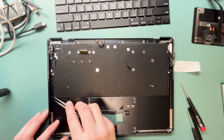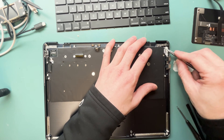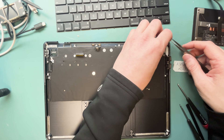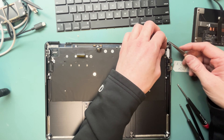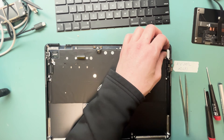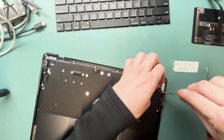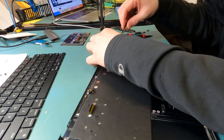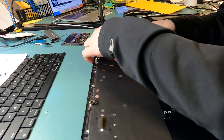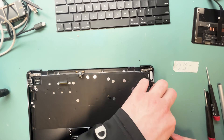So we're ready to start prying off the back. It's held down on the edges by adhesive, so you'll just kind of try to pull up a little bit by bit with the pointy end of precision tweezers, and then once you can get your hand on it, you'll work your way around the edges trying to break it free. You can rip the edges off of it — that's not electronic. There's a difference between the backlight and the tape around it, so you'll want to follow my guide on the video. You can start from either corner, and if you're ever trying to attempt a cleaning of your keyboard, you could just remove this and then clean it from the other side, but most likely you'll just have to replace the keyboard or do a top-case keyboard replacement.